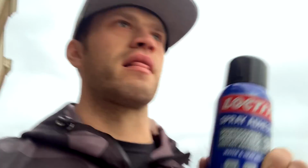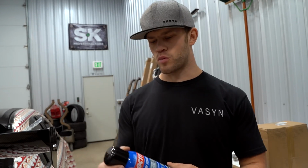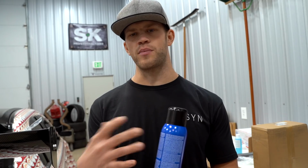Fun fact, guys, you need ID to be able to buy Loctite, and I lost my license a while ago and I didn't have ID. So they almost didn't let me buy a spray adhesive because they didn't know if I was of age. That's insane. Now, like I said earlier, I'm just basing this off of what I've briefly read and watched online. A ton of people were using the Super 77. You spray the part first with the adhesive, then you lay the carbon fiber weave down, and then you epoxy over that. I'm scared, I'm kind of nervous. I love learning new things, and this is so new to me that I'm extra nervous right now.